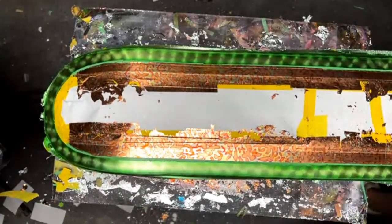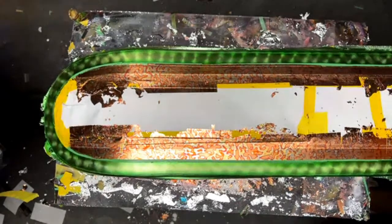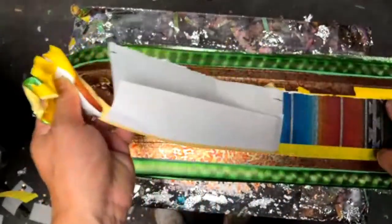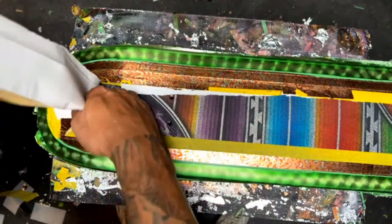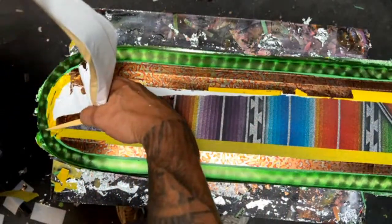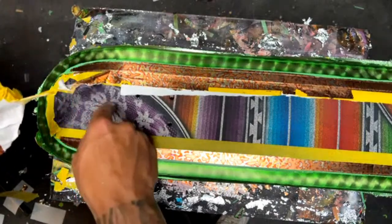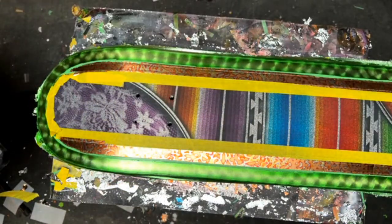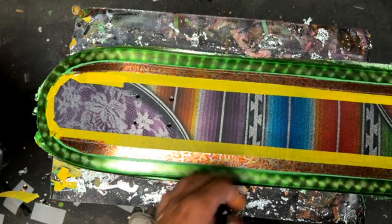Can you speed dry with a heat gun, or do these paints not work that way? These paints really don't work that way. I think speed drying with a heat gun would be more if you're using water based, because water based is going to take a lot more patience and more coats and more dry times, because that water needs to evaporate. It takes longer. Solvents, they just evaporate really quick. So never have I ever really heated anything up to speed it up, besides in a paint booth. Don't do that. With water base, it's actually kind of a normal thing. I think they even have hair dryer things to speed up that process. So you've got the painters in production shops with hair dryers, trying to speed up the dry times on those.